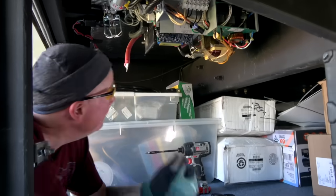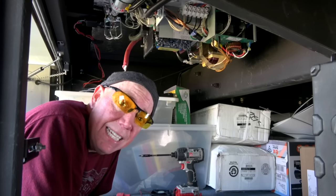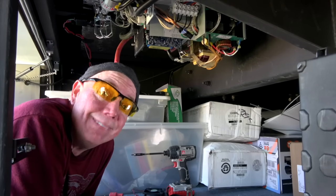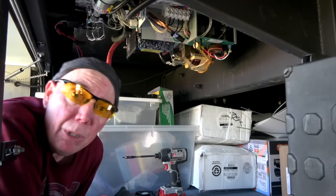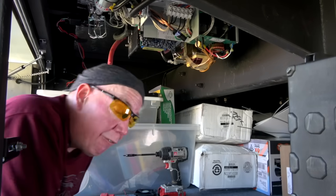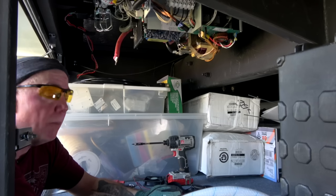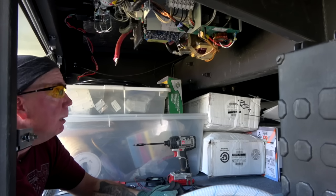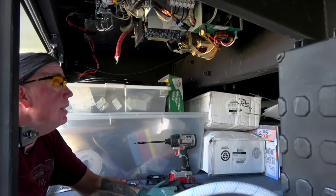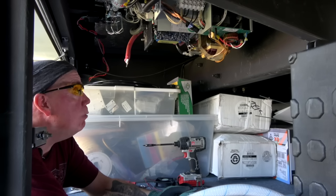Now I'm just going to put this all back together again, going through the steps in reverse. Once it's reassembled I'll have a working inverter again that won't overheat, because the fans will properly cool it as needed. If you ever have this problem, you can order the fans and get them delivered in two days. You can look through the bay with a flashlight to see if the fans are spinning. Remember, they only come on when cooling is needed — so if you have a temperature overheat problem, it will show on your panel. Then you can check through here with a flashlight, order the fans, and do the repair yourself if you feel comfortable.